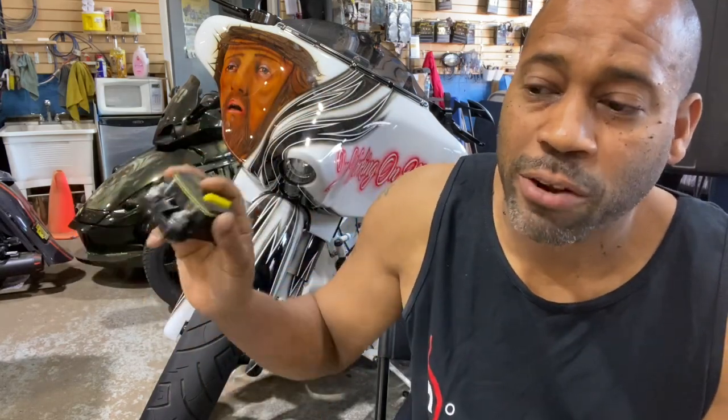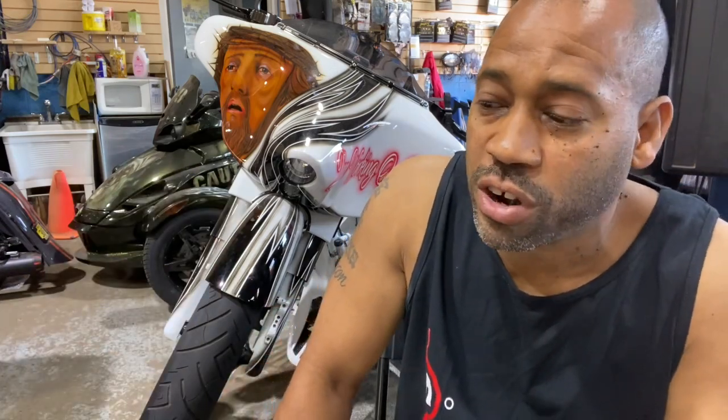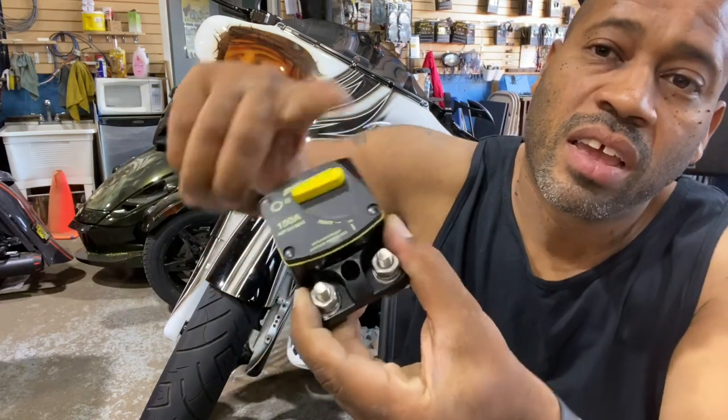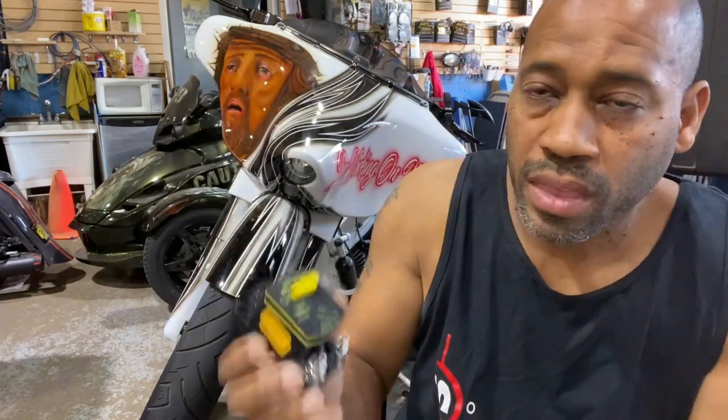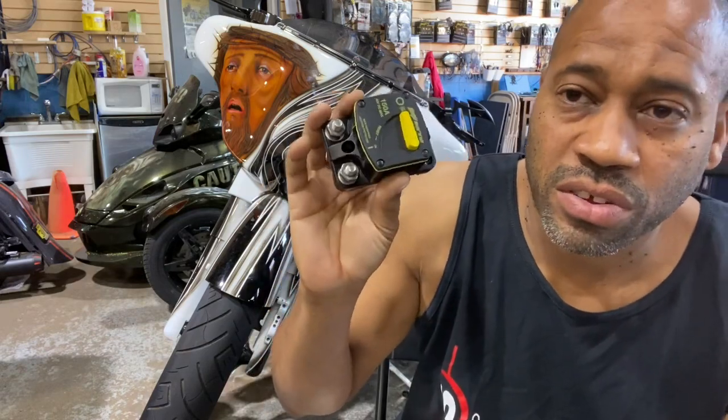You can hook up the lithium battery charger to the rear lithium battery without affecting the front battery, and then plug in a tender or a charger to charge your underseat battery. Once both batteries are fully charged, you can go ahead and reconnect the circuit. So this would be the proper device to use. You could also use a fuse.